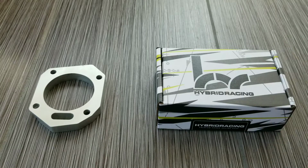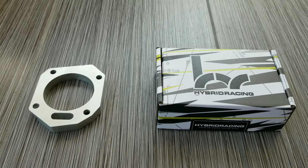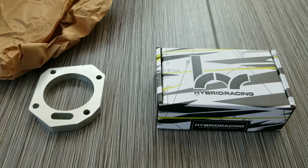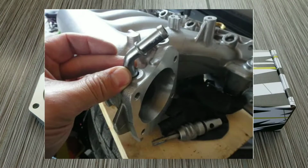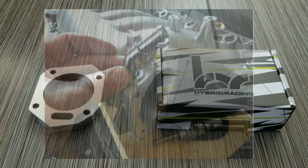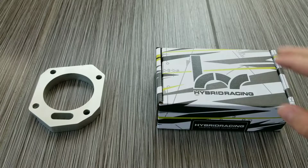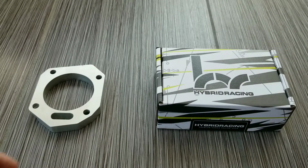So when I went to adjust my mounts to the K20 setting, by the way, which I'm running Hasport's EGK2 mounts, I needed to cut the hood, obviously, but the RBC sits higher, and I had to cut a lot more. And my bar fitting on the top, I'm going to put a picture for you guys to see, got in the way of the hood, so I dented my hood a little bit, and I have to relocate it because it did bend. So I'm going to get into it and then show you guys.